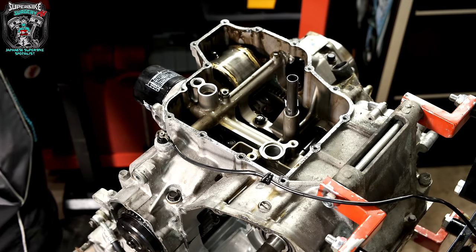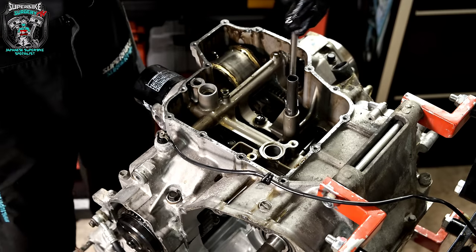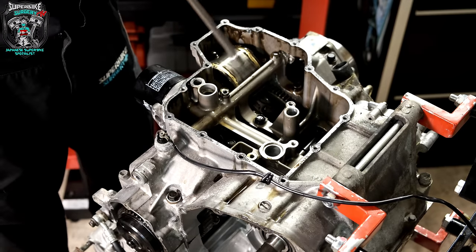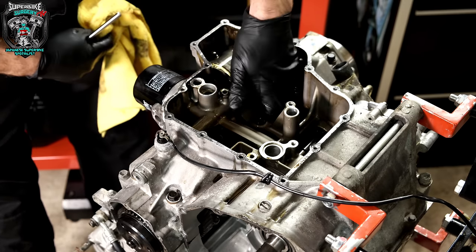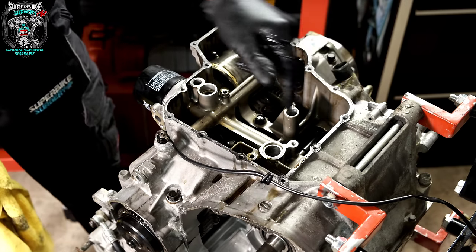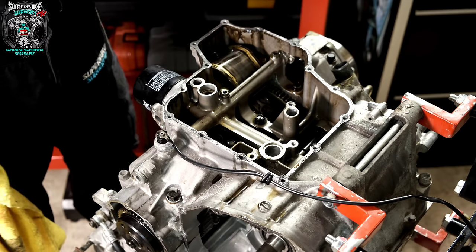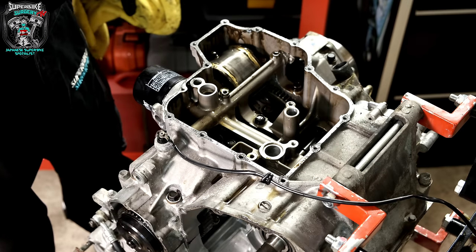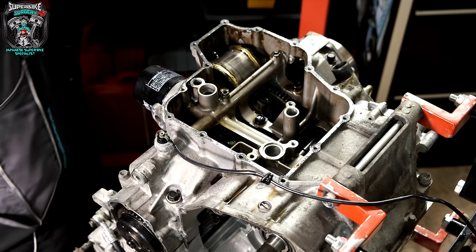It's minging in there — it's going to need a good clean out. Given the state of the contents of the sump, I think I'm probably going to have a look in that oil pump while I'm here. It's not a big job to take it off — be silly not to. So that is pretty much it in terms of what we need to take off to start splitting it. I need to do some modification of my engine stand so I can split it, but that's easy to do. There are some bolts coming up from the underside as well.